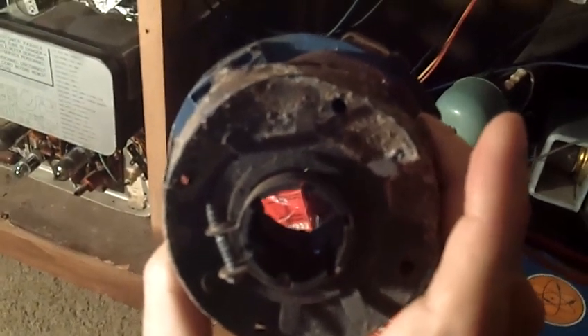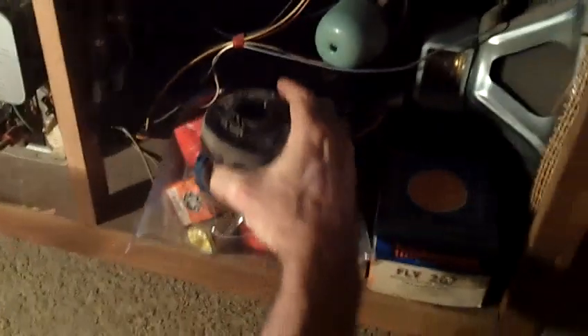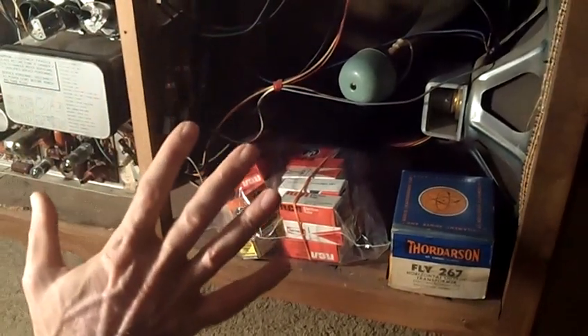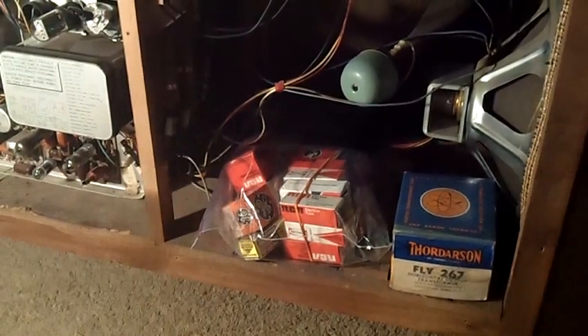Let's take a look at this. This plastic has deteriorated pretty badly — that's the way I got it. I had to find a replacement piece of plastic because it was pretty bad. That plastic all it does is hold the two metal rings together that are used for centering the picture on the CRT, but I was able to get it taken care of.